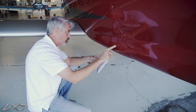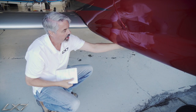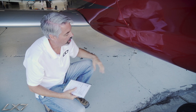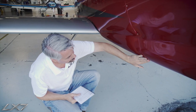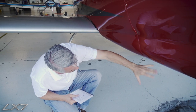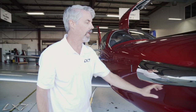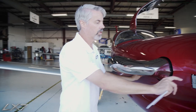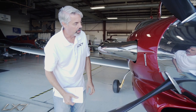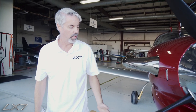As we make our way down to the wing root and forward of the nose, we've got the exit area for the cowling air to pass through the oil cooler and exit overboard — make sure that is clear and not restricted in any way. Cowling hardware is present and nothing is dripping out of the breather system. The cowling latches are latched and the exhaust system is installed such that we can see both sides of the hardware — the nut portion — to validate it's not loose.